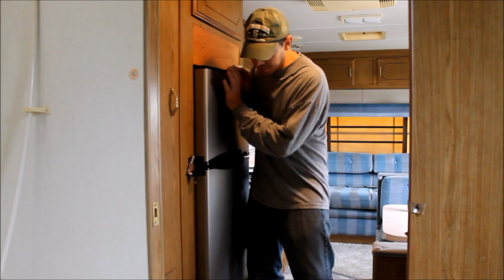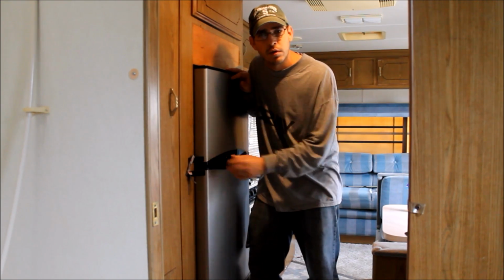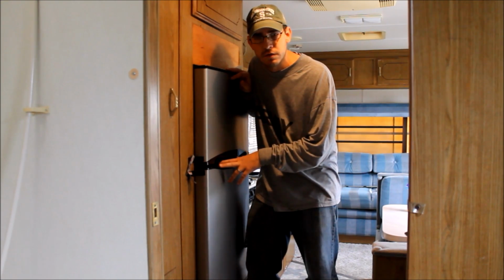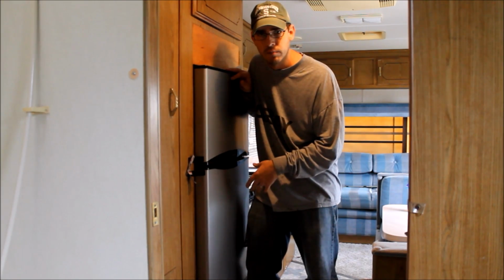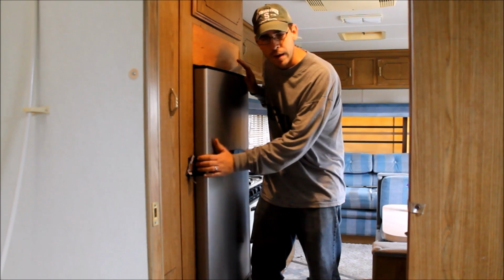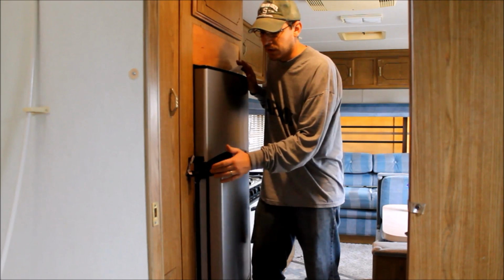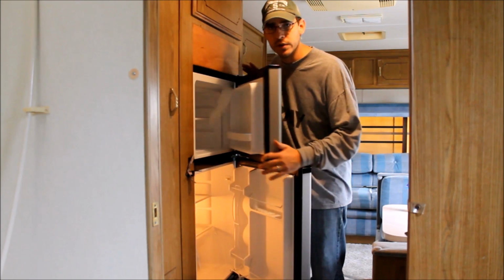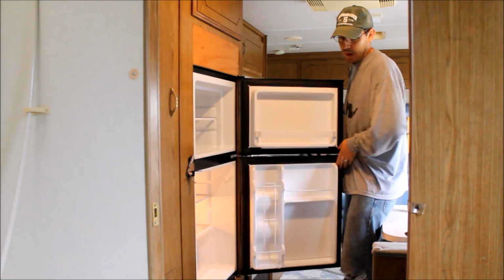You always want to make sure, now this is a residential refrigerator that I actually installed, and I'll have links to some other related RV videos at the end of this video, so if you're interested in how I installed this or removed the old one, I have videos on that. But this is just a regular residential refrigerator, but no matter what kind of refrigerator you have in your RV, you don't want to leave the doors closed over the winter or anytime you have it in storage, really. So I always leave mine just wide open.